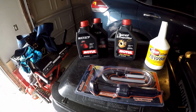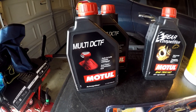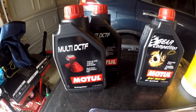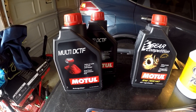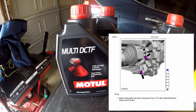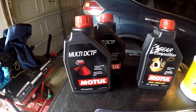Here are all the fluids you're going to need. Starting left to right: first is dual clutch transmission fluid. The most common one is Motul; I've seen some people use Liqui-Moly. As long as it's dual clutch transmission fluid you can't go wrong — better quality means longer life depending on how you drive. You'll need two quarts. It uses a T40 Torx bit on the driver's side — take off the driver's side wheel and you have upper and lower drain plugs. I'll attach some pictures. The car is hot today and it's freezing, so I'm not staying in the garage longer than I have to.